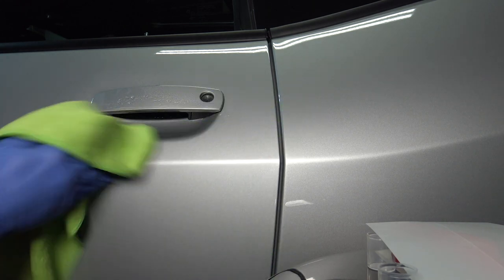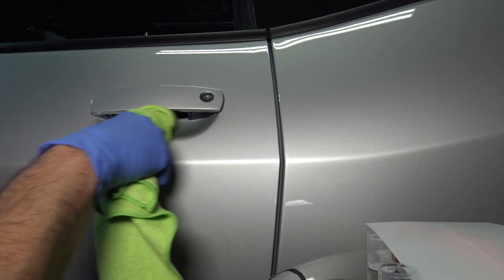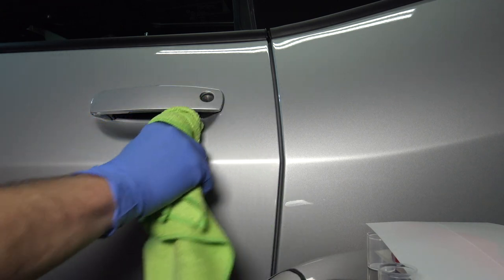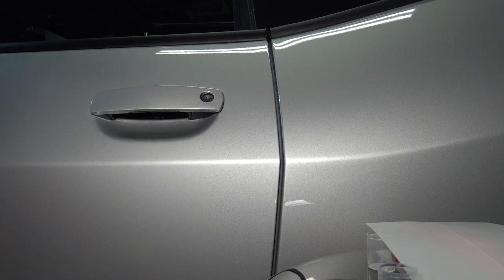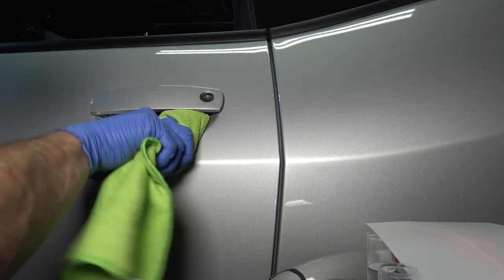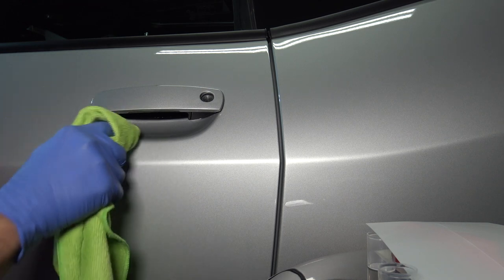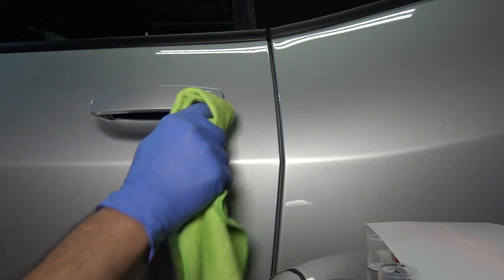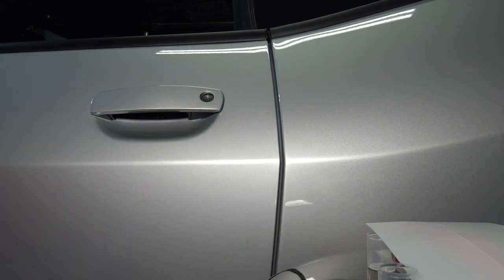I'm also going to take a blow dryer here in a minute. If I had a heat gun, I don't know if I'd use it — I don't know if that's really necessary. I've got a blow dryer that I've been using for years for RC car bodies, but it's great for this use. We'll go ahead and squeegee it out a little bit more, let it dry, and you can't even see it — I don't even know if you can see it on camera, but it's invisible, it's fantastic. So if you have wear rings and stuff like that, the paint can scratch under here very easily, so it's worthy to give it a little bit of protection. I'll come back and lay a nice little layer of ceramic around that — I'll even put it on top of the PPF to give the PPF its own protection.